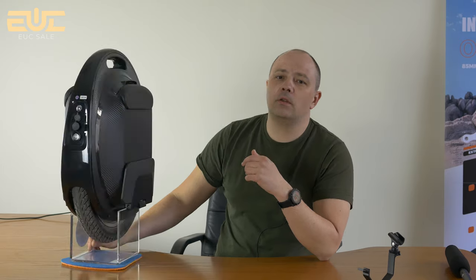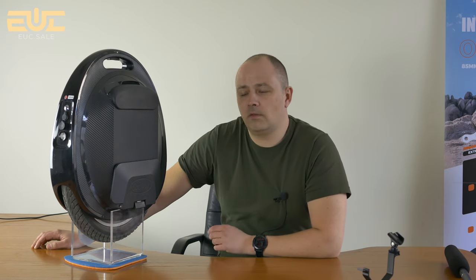Okay, so about overall experience, in my opinion, yes, this wheel is really very fun to ride. It is definitely more fun to ride compared to the Tesla 2, and this wheel has a new type of motor, a hollow motor. I don't really believe that the hollow motor will be the future just because of the waterproofing. The bearing issues with all manufacturers are the same, and in the past 6 months nobody can do anything to fix that problem. But if the wheel gets water inside the bearings, they begin to rust, and in a few more 100 kilometers we are out of order.